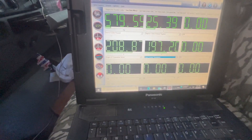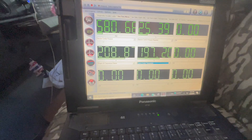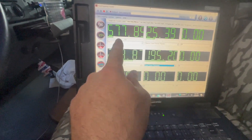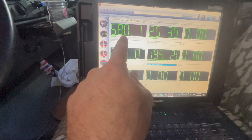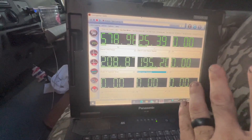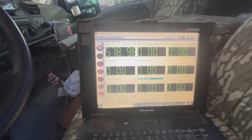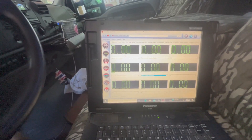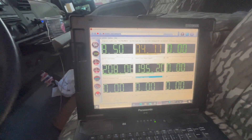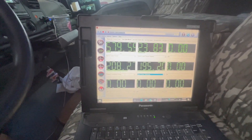It's studded, EGR deleted, tuned, but it's probably never had an oil cooler done with 150,000 miles — unless they did it when they did the head gasket job, which is a smart thing to do. She's probably due for an oil cooler looking at that. But I think we corrected our high pressure oil pump problem — sitting here at idle it's been right around 577-580 and as the temps have gone up that is not dropping. I'm going to turn it off. It'll probably be a long start still because whenever you open this system up or air test it you're going to have a long start.